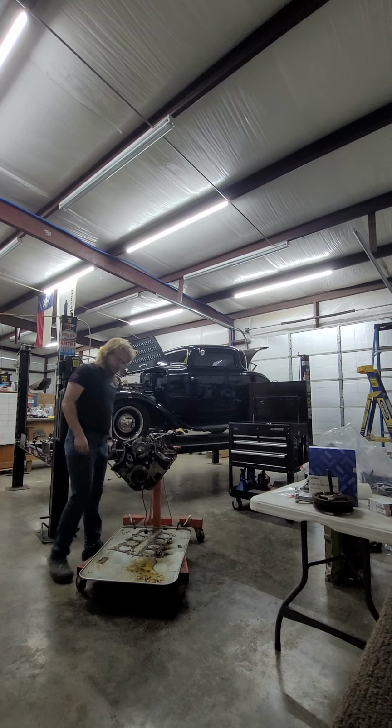Did we not mark these rods? No, we didn't. Should we go ahead and do that? Yeah. I'll go ahead and pause the video. That's okay. Show them how we did it. I guess we'll just go ahead and get it recorded. He's going to get the engraver and this flat spot here on the end of the piston. We're going to mark all the numbers of the cylinders. Where'd you put the engraver? I didn't put it up. 1, 2, 3, 4, 5, 6, 7, 8. This is piston 7. So go ahead and put it right here. And this is piston 3.